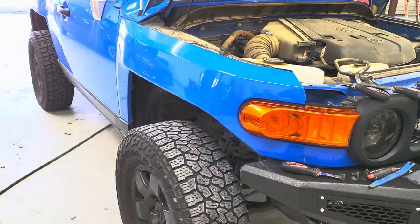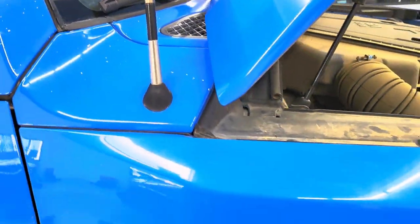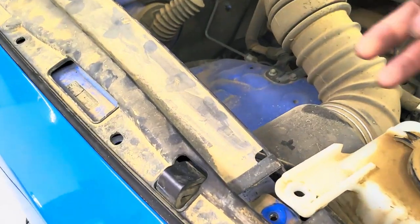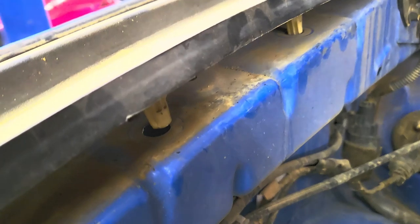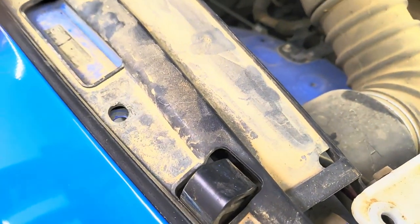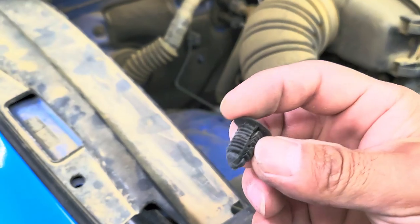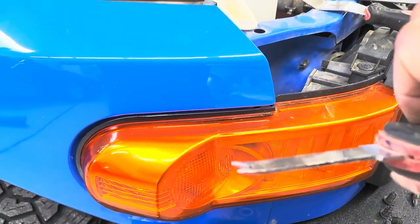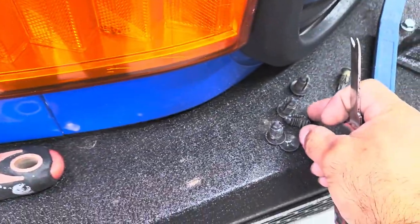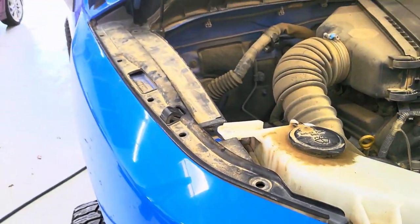If you're trying to install a snorkel like me, I bought one that goes right here and you don't have to cut anything, so that was my preference. The next step would be underneath here — there's some clips you can see right there. Use a clip tool to pop them. For these front ones they're kind of hard to remove and sometimes they snap. A friend of mine showed me: use a clip tool on one side and then on the opposite side use another one, and you basically wiggle it out without breaking them — though sometimes it happens, I broke one, but I'll replace it.